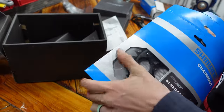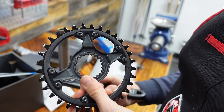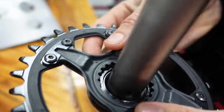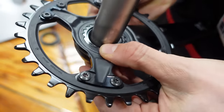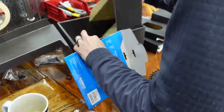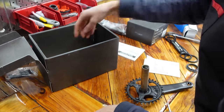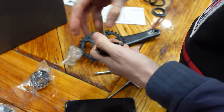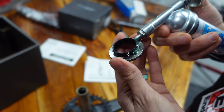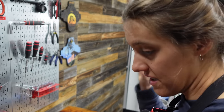First step: put the chain ring on so you don't get your crank on without the chain ring. The side that looks nicer goes out — on this one it's very clear. It only fits one way, so just find the big alignment tab. These are very important things to remember — we actually lost one of these widgets once and it's been a headache since. The chain ring bolts need grease. At some point we want to do a video about what to grease versus what to Loctite because that's such a sticking point for me.